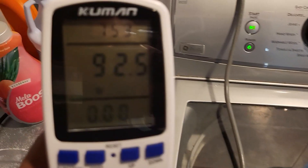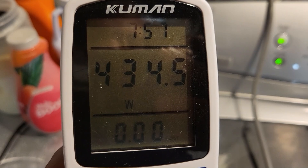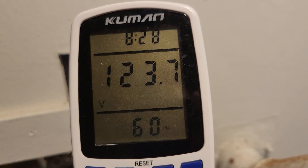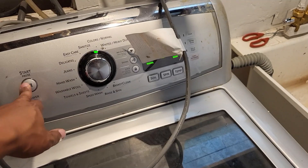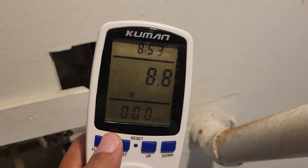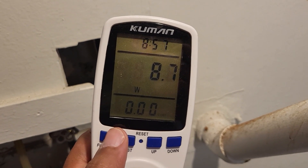I don't like the way this sounds, so I'm gonna unplug it and get it off of the power station. I think we need 120 volts because it seems like it's struggling getting the tub moving the way it's supposed to. I've plugged it back into the wall — you can see the voltage coming off this is 123. Already seeing 80, 90 — it's running water sensing.